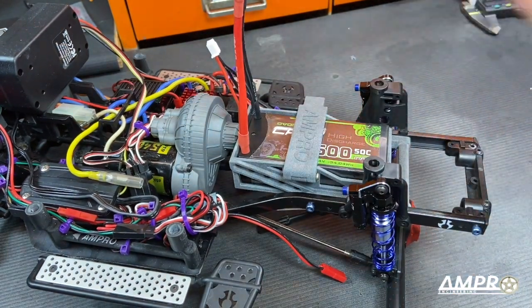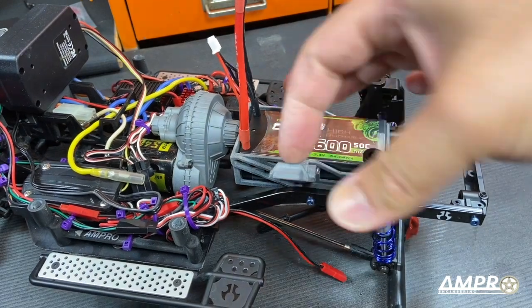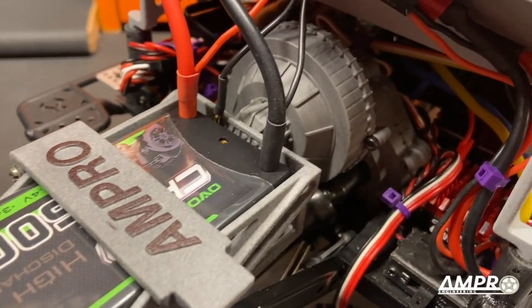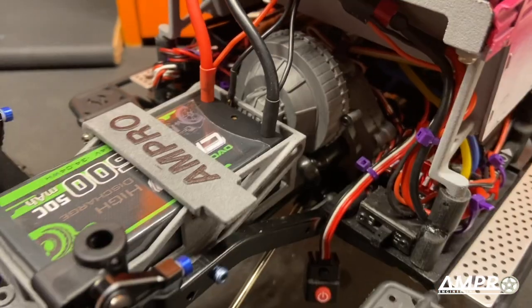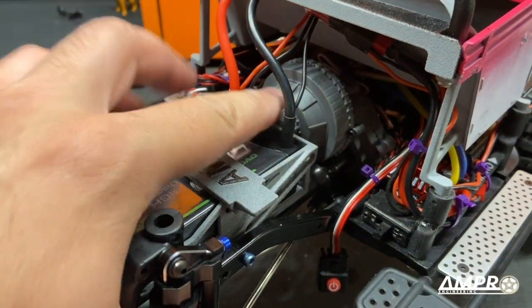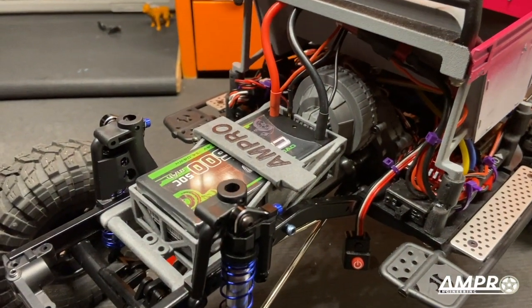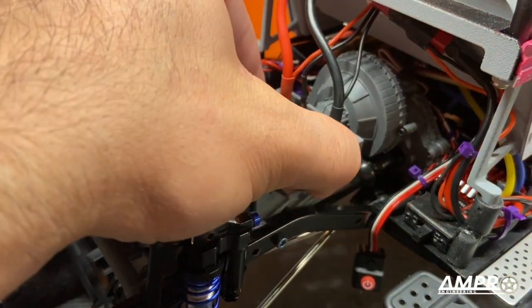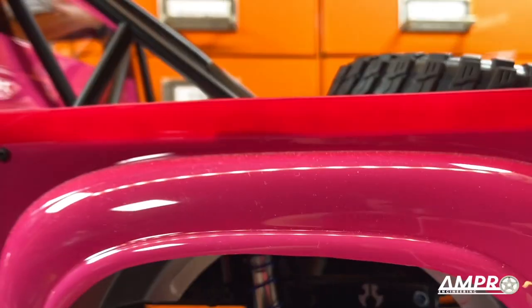To remove the battery, I'm putting my finger here, pulling up there, and there it goes. It should hold right in place very nicely. I wanted to note that this vehicle has the AX10 transmission. If this car is equipped with another variation of the transmission — or perhaps even an aftermarket version — that could definitely compromise the placement and clearance of this battery tray.